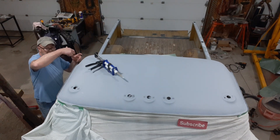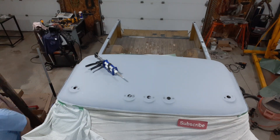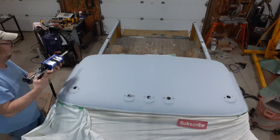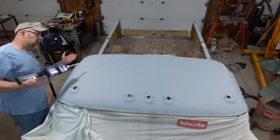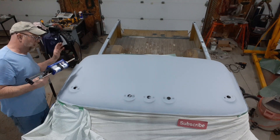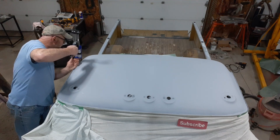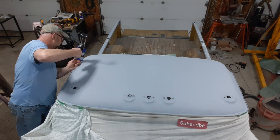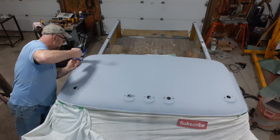You're going to start right in here, come right around this side, keep going right around that side. The reason we do this: I have started them in the middle and worked your way out, and there's a small problem with that — it will set up a little bit before you get back to the other side, and you can notice a little overlap when you do that. So we're going to start right over here on this side. When you start on this end, realize it's going to run that way, so be prepared for a small drip. GM, believe it or not, had a small drip on there right from the factory. I usually put a little more than I probably should, but I don't want it to leak.